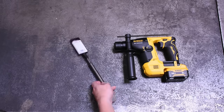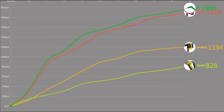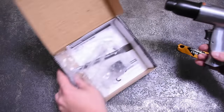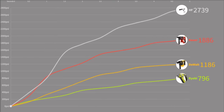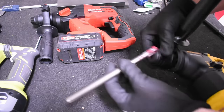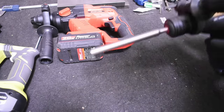But can they be used as an air hammer in a pinch? We've tested plenty of those, and the closest comparable to the performance we saw today is the Dynamic Power, or DP — a short barrel air hammer that performed best in its class but is not a heavy hitter. Here's what a $15 Harbor Freight medium barrel air hammer's performance looks like versus the SDS models from today — not looking pretty. That's barely enough to separate a tie rod ball joint, much less knock out a ball joint or dislodge a wheel hub in our experience. The closest in size and cost SDS drills cannot be used in place of a traditional air hammer or breaker. Though we wonder if there's a middle-ground model offering impacting similar to the Milwaukee but with a smaller SDS Plus bit and lighter weight. Let us know if you think that exists.